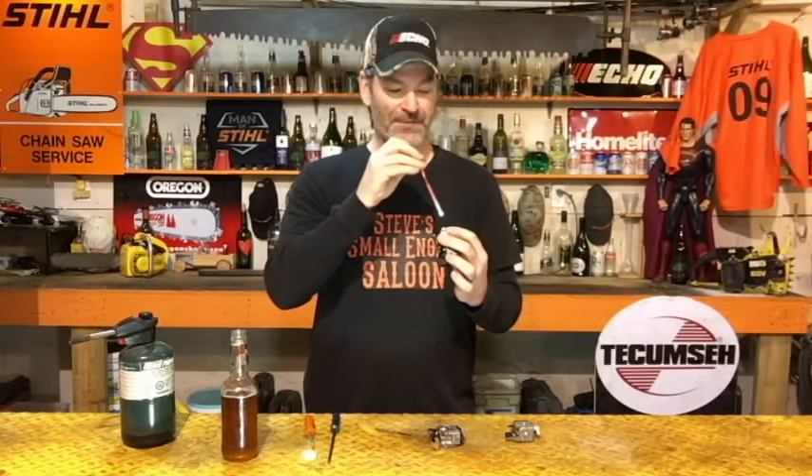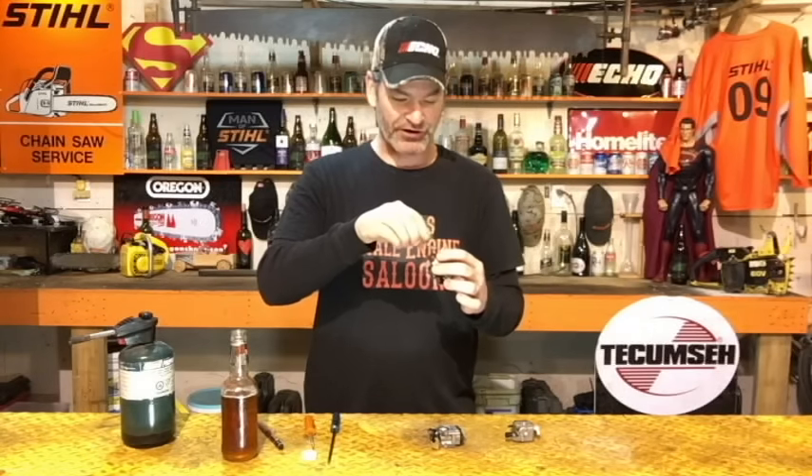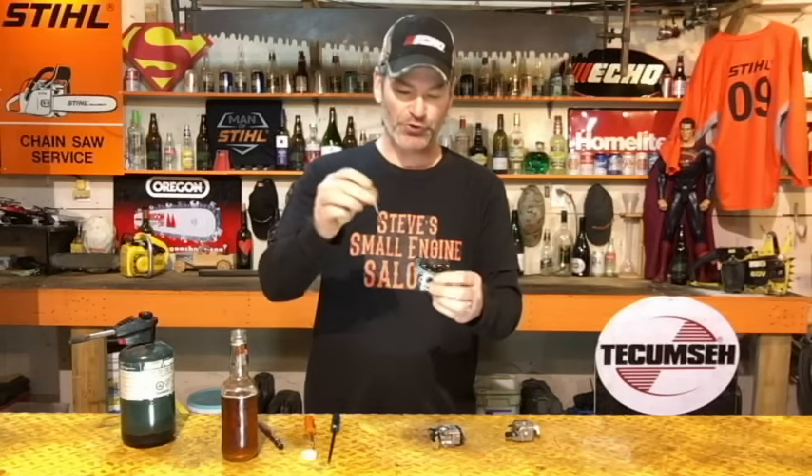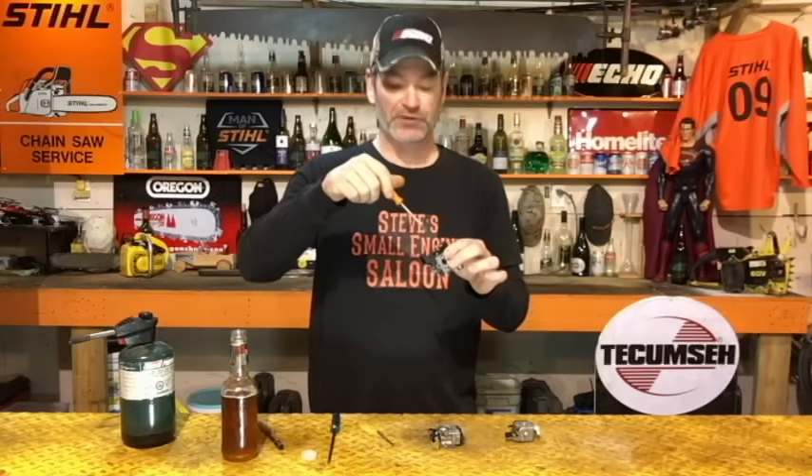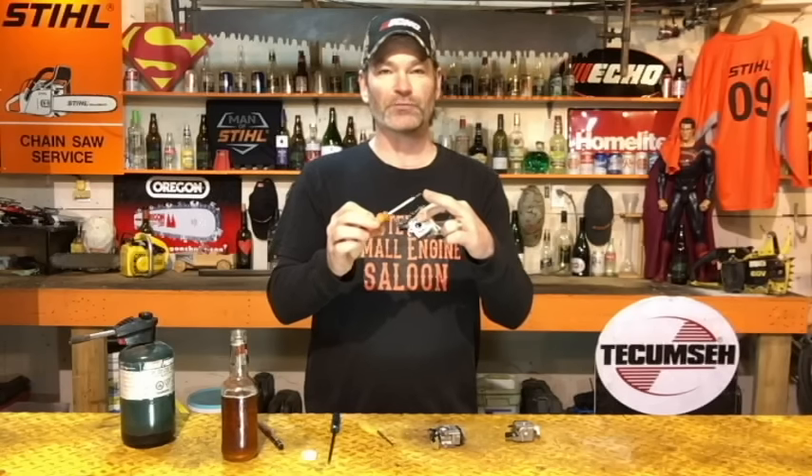You'll see a little plastic plug melted on the end of that screwdriver — just knock it off or cut it with a razor blade. Then look down in there with a little flashlight and you'll see a little slot in there. That screwdriver goes right back in and now you can turn it. Do the same thing on the low-speed screw down the center of that barrel on the top of your carburetor. Get those plastic plugs out and you're good. That's your Zama carburetor — now you know where the low-speed and high-speed screws are.